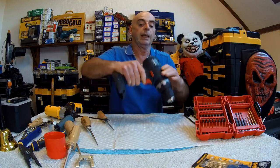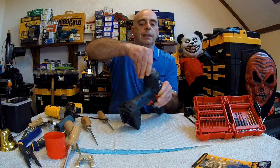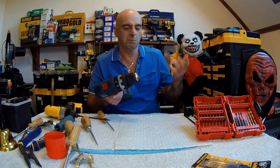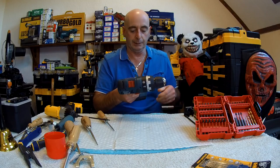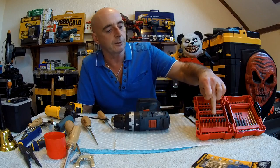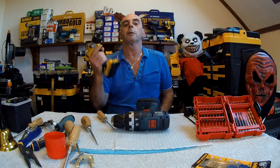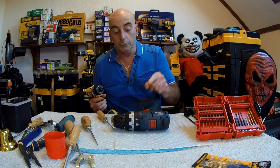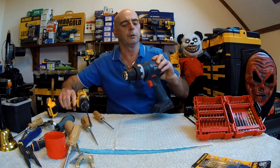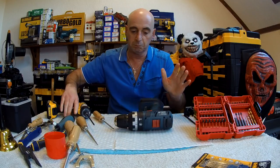So we've got the bits we need. We've got rid of the belt hook, we've got rid of the battery. This piece at the back has to come off — just do it that way and it comes off. Some of you have probably lost that bit already. Set the drill down and remember it has the long T-bit in it. I'm going to use this — it's underpowered, but brilliant for this job. Set it to center position and make sure you're on speed one — it seems easier that way, though it probably works fine on two.